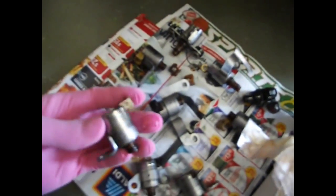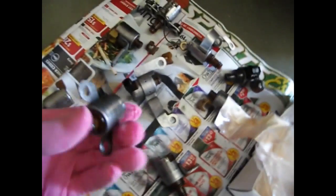And these are the old solenoids, the old ones that I replaced. See folks, it's possible that probably only one or two of the solenoids caused my hard shifting, but since I'm doing something like this and removing the fluid pan, I might as well change all nine of them. And you can buy them as a pack on eBay. In this case I changed all nine - here they are, the old ones. No big deal, this is all they are - solenoids.